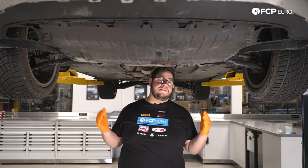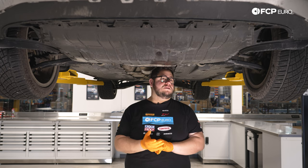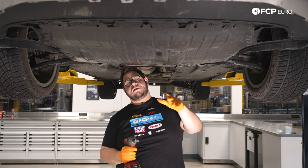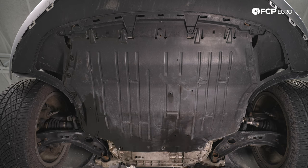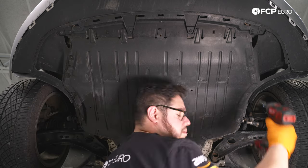We are under the Mark VI. Our first step is to remove the splash shield as well as any hardware holding our front bumper cover on from underneath. We have about seven T25s holding the splash shield and three T30s along the back, plus another six or so T25s along the bottom trim of the bumper — not counting the hardware in the fender liner. Start with the three T30s in the back, be mindful as you drop the shield since there could be debris, oil, or fluids. Then switch to the T25 bit and get the rest of the hardware out.